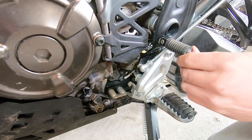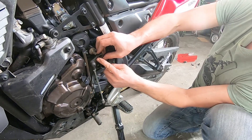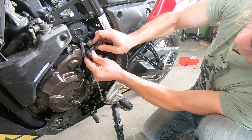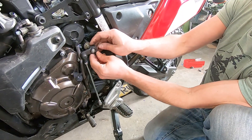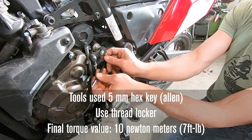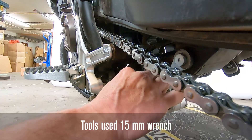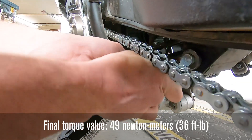Now reset the shifter back into place. Sight the line down the center from the spline shaft — make sure you're aligned. If you're off by a tooth, come back and adjust. It's flush and you'll catch that groove with your bolt — remember that locking groove. Torque the M5 bolt back to spec. Then use a ratcheting 15mm to capture that M10 that we had set in the beginning and finish tightening it home, cinching it snug to spec.